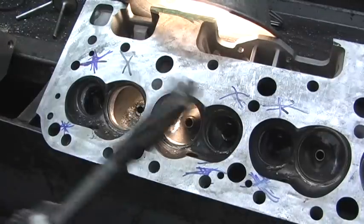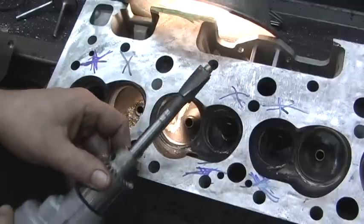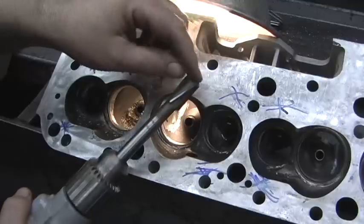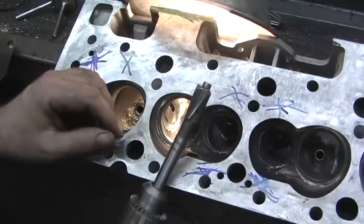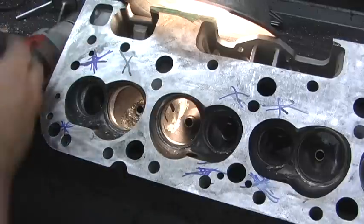We got a situation here. I want to point out that I do a lot of aluminum heads. What this is is a 750 thousandths diameter arbor. It has an 11/32 pilot. And what I do is — we got guide overhang here from the base of the aluminum.